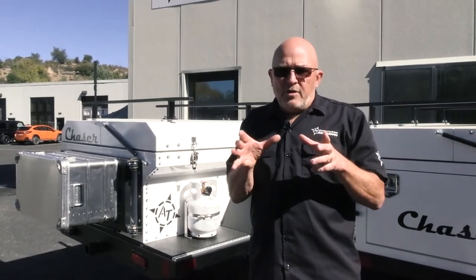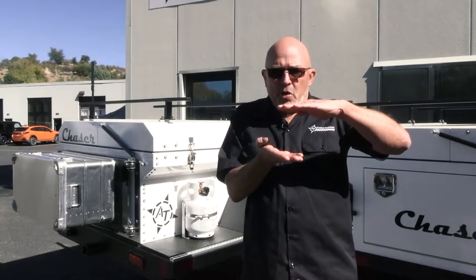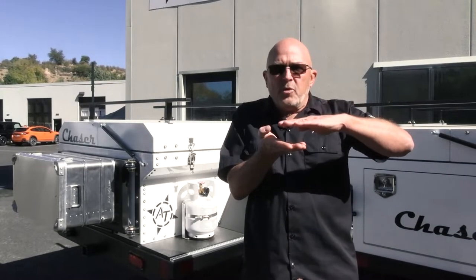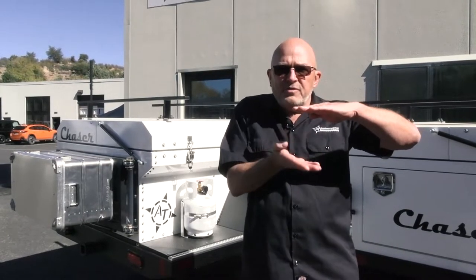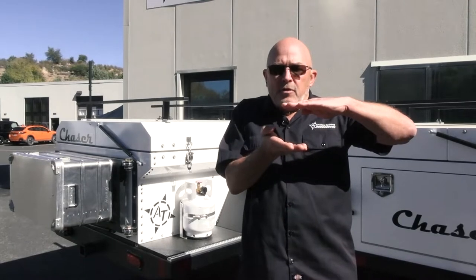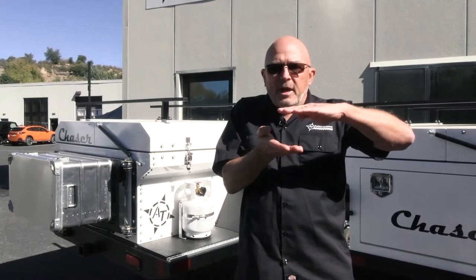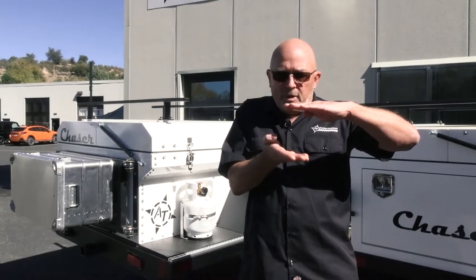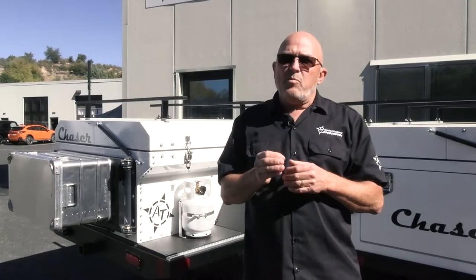The beauty of an air suspension is it has a wide range and it's variable. If your trailer compresses under added weight, you add air and bring it back to its ideal ride height, so you always have the ideal compressive travel. If you're running light and the suspension is stretched out, you can take air out and get it back into its proper compressive length. Regardless of whether it's heavy or light, you can set up an air suspension to operate the same way in all conditions. That's why we do that.